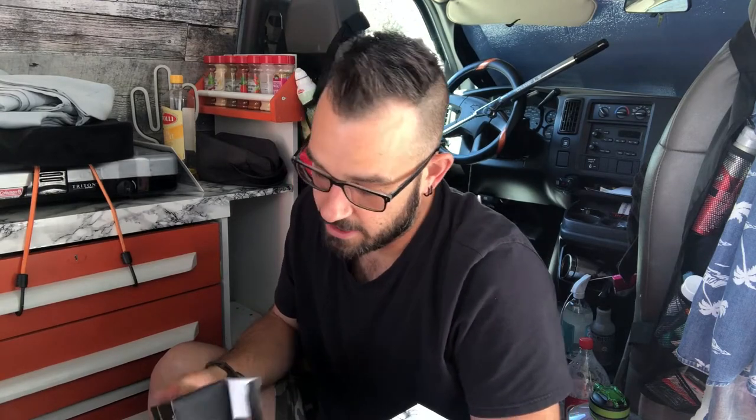Power - this is a No Code GCP1. I know what it is - I found it on Amazon and learned after that you could also get it at Canadian Tire. It's just a very simple extension cord: you plug in here, boom, other end right there. This is going on the outside of the van, it'll come through here, and then I'll have shore power - which is just as cool a word as bulkhead. It should be quick and simple - just use this two-inch hole saw to make a hole in the side of the van. I've seen people do it from outside in and inside out.